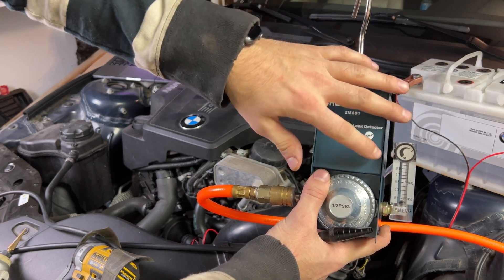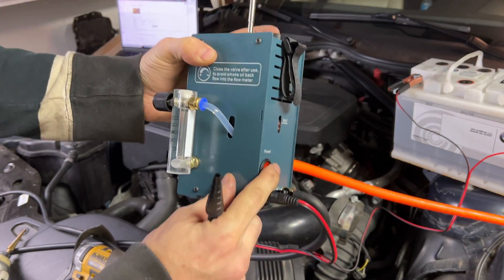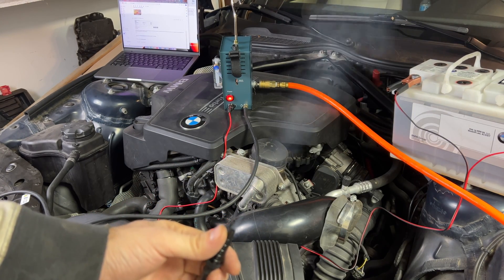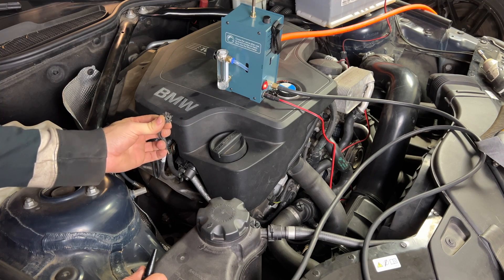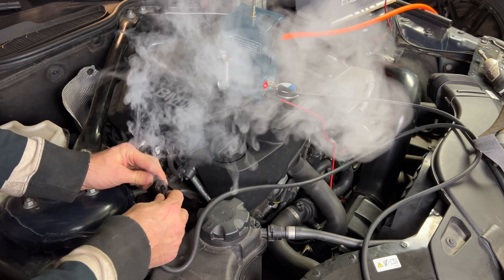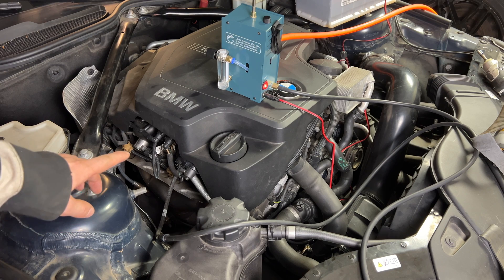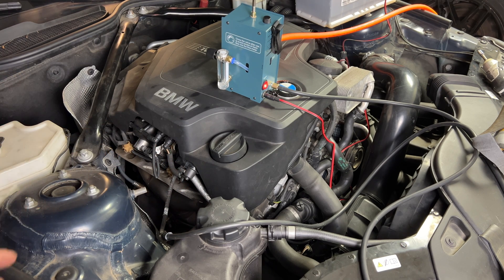Let's put all of this together now. I'm going to put as much volume of smoke and air as possible. I'm going to turn it on — it is on. We're making smoke already, and it's getting denser and stronger as it's warming up. I've decided to use this vacuum line to introduce the smoke into the system. Let's bring out the flow — there you go, plant your smoke, put that in. And now we wait and see if there is any smoke coming out anywhere else. As you can see, there is a tiny bit coming from here, so maybe this line right here is not fully secured.